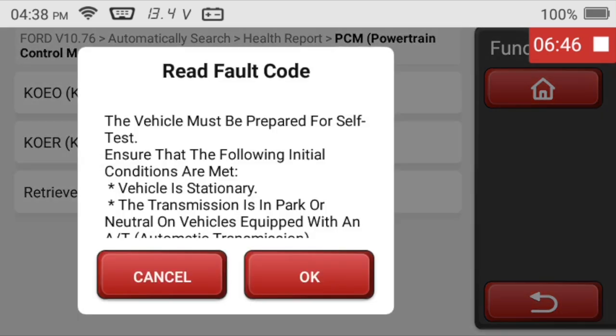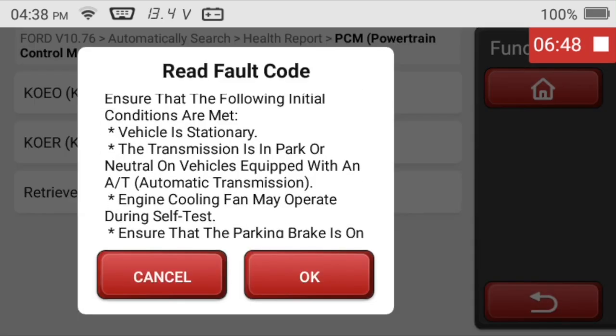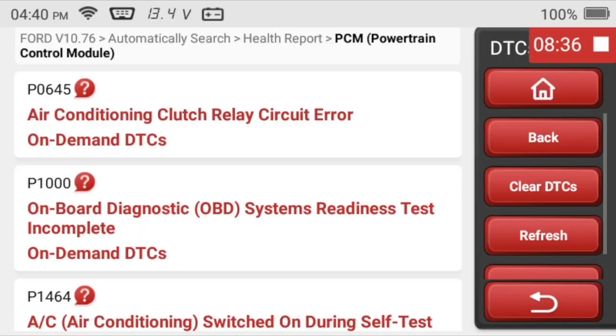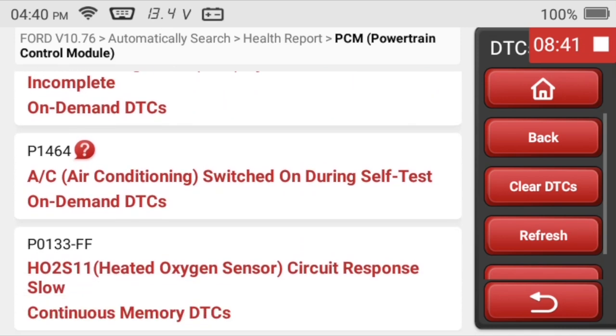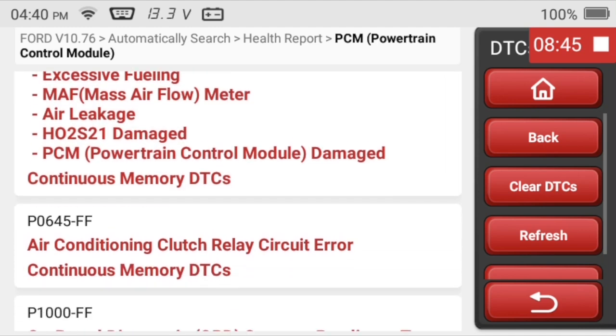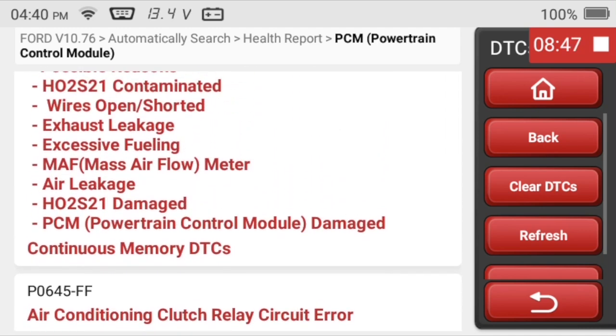Now the PCM, and I'm going to run the full test. I get a warning that I should not perform a PCM test while driving down the highway — check. The test takes a few minutes to run, and like my other tests, I get the HVAC codes because the AC is running, and the P1000 because I have emissions problems with my O2 sensors. The generated report of all the errors is concise and easy to read. The S500 also has four reset functions for the oil, emergency brakes, steering sensor, and electronic throttles. It supports 75 car brands, including European.